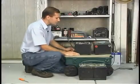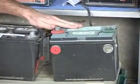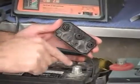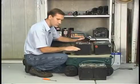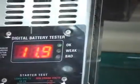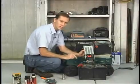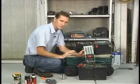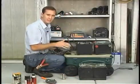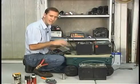As far as maintenance is concerned, we have a couple of different kinds of batteries here. This is called a maintenance-free battery — we're still going to do some maintenance to it, but it doesn't have the caps like this other one has. If you have a battery with caps, you can pop them off and look down to see the acid level. If the acid level is below the plates, take some distilled water and pour it back into each cell until it's above the plate. Right now, as soon as you put a load on it, it goes straight to red — 9.7 volts — and that won't start the car very well. Even if it did start the car, as soon as you cranked on it a little bit, it'd go right dead. If you have it checked at one of the local parts stores, you'll be able to tell before it fails and replace the battery in time.